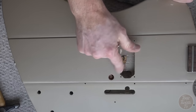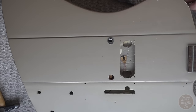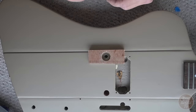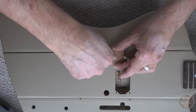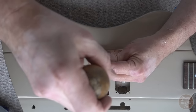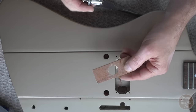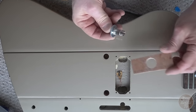I can see from this that the lacquer is about a millimetre thick, so we're going to have our work cut out getting this stuff off. Despite my best efforts, this one isn't coming out with the dowel method, so what I've done is just drilled a hole that's slightly wider in diameter than the bushing, which I'm placing over the top. I've got a washer which is just wider than the bushing, and with this ultra-sophisticated tool I'm going to pull this thing out. There you go, simple as that. You can buy specialist tools to do this, but all you really need is a washer and a piece of wood with a hole in it — it came out super easy.